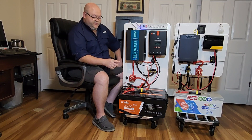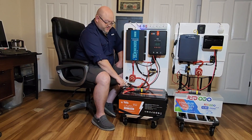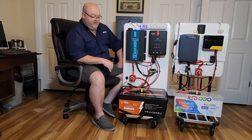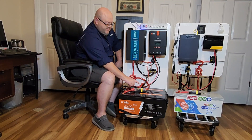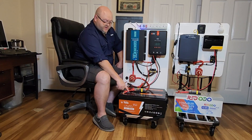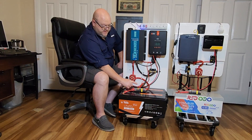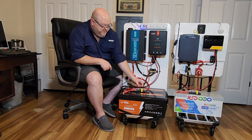Make sure that whenever you do a portable power station like this, you keep your fuse close to your batteries — as close as possible, within five or six inches. That way your fuse is there to protect your wiring in case something happens. If you're interested in that New Concepts wiring, it's linked in the description. On both of these I'm running the Blue Sea Systems fuse holder, and I'm going to undo it and show you why.